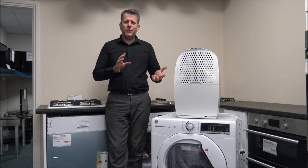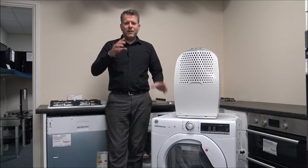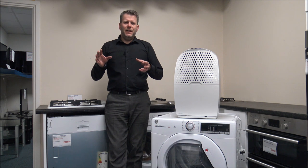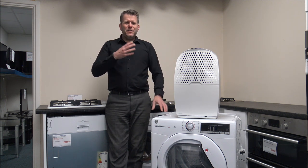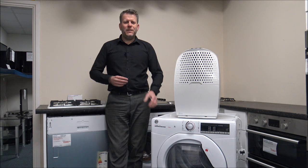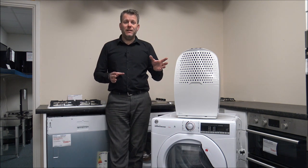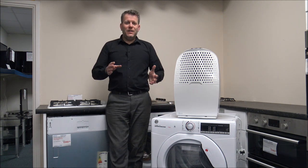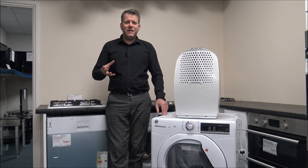The other side of the coin is not to underload the machine. A lot of modern washing machines have a balanced spin control that detects if it can't balance the load out and won't spin to its full spin speed. Some people try to put in one large item — a duvet cover, a pillow cover, or a couple of flannels — and there's not enough in there to balance the load. So you need to put a half-decent load in to allow the machine to balance out and spin to its full capacity.